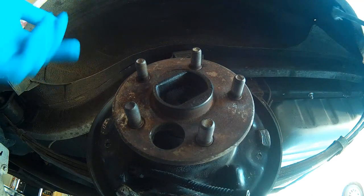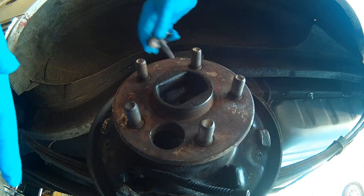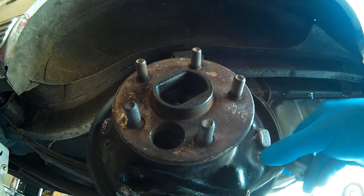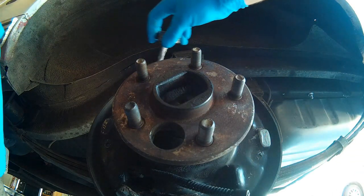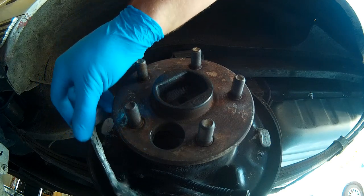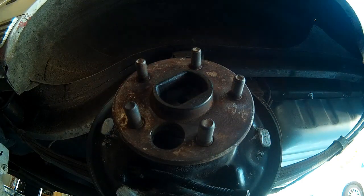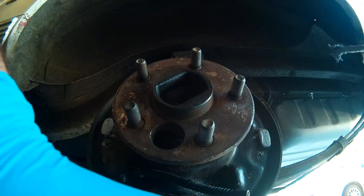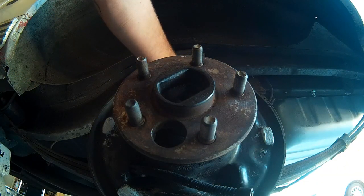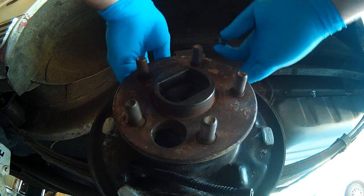Okay guys, we're going to assemble the brakes here on the rear drum of our Mustang on the driver's side. We're going to give all the contact points a good liberal coat of anti-seize to provide some lubrication. Anti-seize sticks in place really well, so it doesn't move all over on you and squish out like grease does. We're also going to anti-seize our hardware as we put things back together. First up, wheel cylinder — and I just stuck it in the wrong way. It's going to be one of those kind of days.